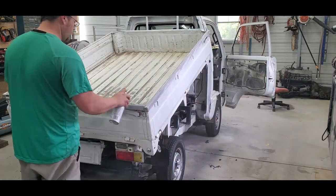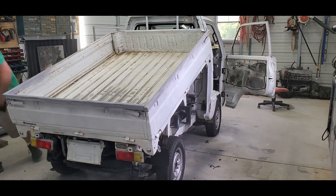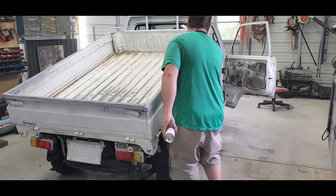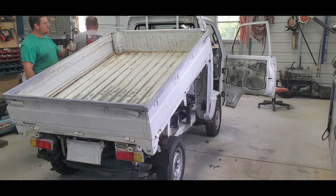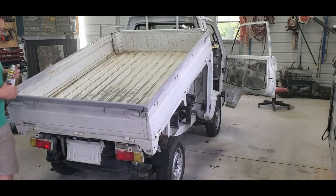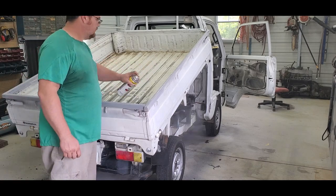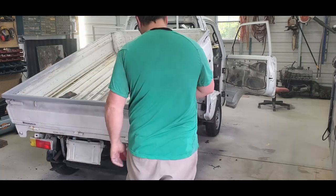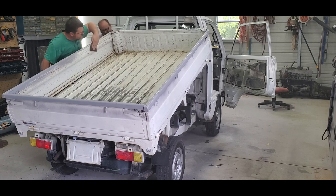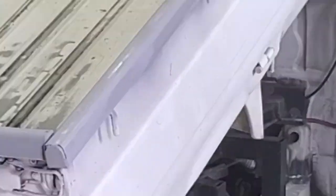You can see I'm now priming certain sections just to make sure there's no rust that forms before we paint. I'm also taking a scuff pad and working on small dents that are easily removed to clean up the sides. There really wasn't a lot of dents on this vehicle — it did come from Japan and is a right-hand drive. For as much as these things go through, this one was relatively dent-free. The main damage was the toolbox and the battery cover, which needed straightening, plus a few minor spots around the body that didn't take very long at all. I'm definitely not a body shop person — my background is mostly mechanics and electronics — but with a little YouTube knowledge you can straighten this stuff out pretty easy and make it look good.